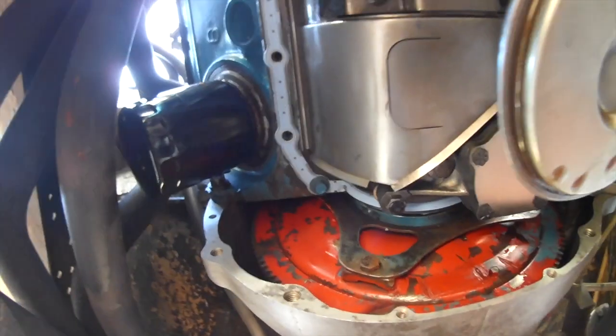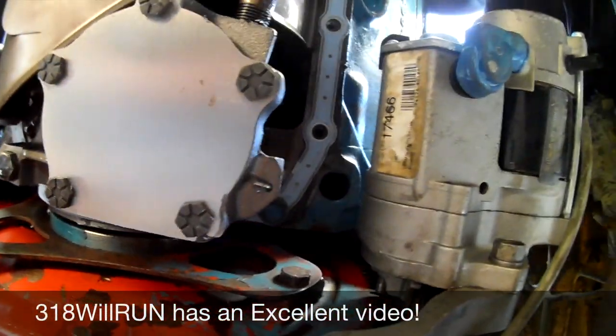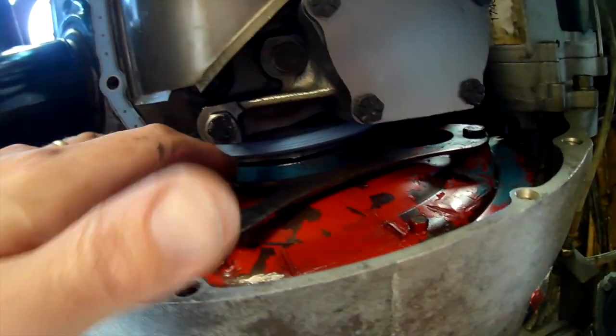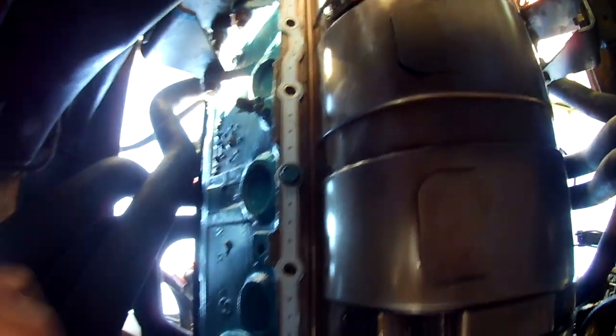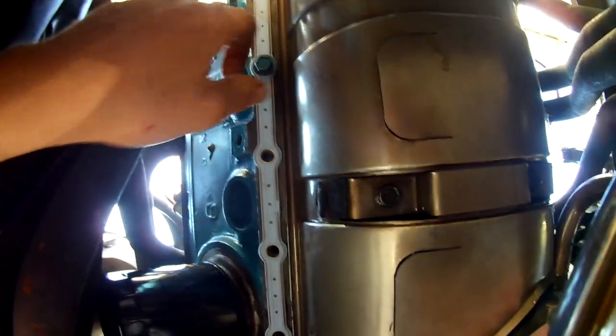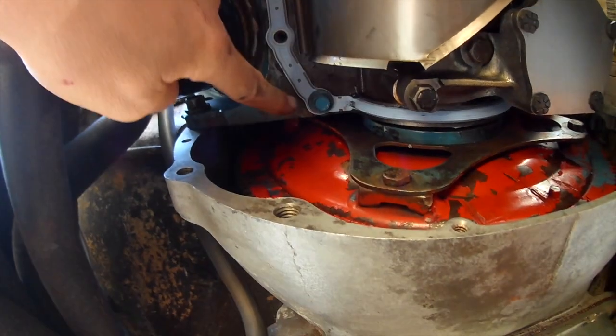All right, I wanted to show y'all real quick. I didn't used to know this, so I figured I'd share with you. This is an oil pan gasket from a 2000 Dodge 1500 with a 360. Just be sure and tell them 360 if you got a 360, because the seal in the back is different. But I think it was $37 at O'Reilly's, and I just got it bolted in place right now to glue it. I'm using a little bit of black RTV underneath it.